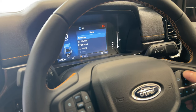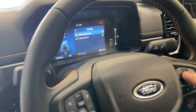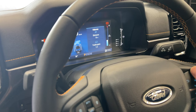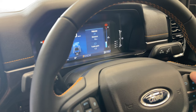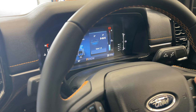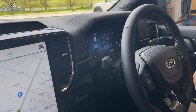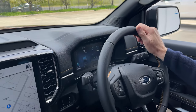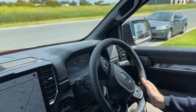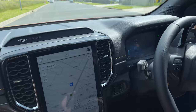Within the menu function accessible from the steering wheel, we now have a towing menu since the trailer is hooked up. The trailer information shows how far we've travelled — excellent if you're tracking axle hours or distance for bearing changes. It also tells us the current gain setting on the trailer. Going down a level, we have the gain there as well, a yaw indicator showing up or down, and steering wheel angle setting. Trailer gain is set at 1.5 — let's drive and see how that plays out.